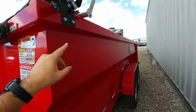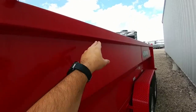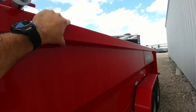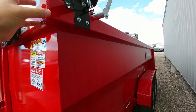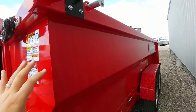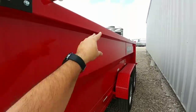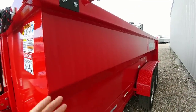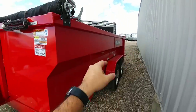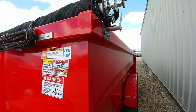In the case of Texas Pride, they use heavy wall boxed tubing as the top rail. This piece of top rail is separate from the wall and it's welded to the wall after they attach it up here. This heavy gauge boxed piece of steel adds more structural support to the trailer than simply attaching a C-channel or side bracing to other parts. Texas Pride puts this boxed heavy-walled section of tube going down the sides, the front, the other side, and even throughout the gate. So instead of giving you the perception of a top rail, they actually give you a boxed section — and that's really nice.